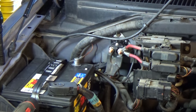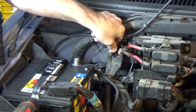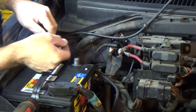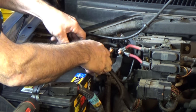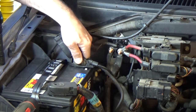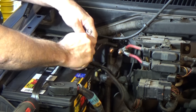Next thing to do is hook up our control wire — that just slips right on that bolt; it's just kind of pressure fit. And we hook up our negative cable now and we should be good to go. I'll go inside — we don't need a helper for this one. We can just turn the key and we'll see. We'll do it actually a couple times just to make sure.